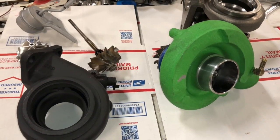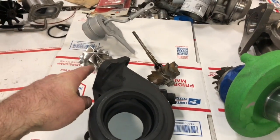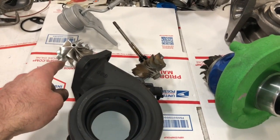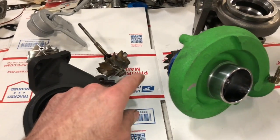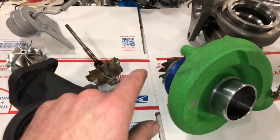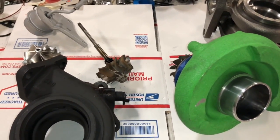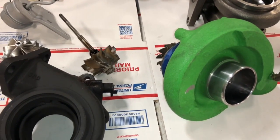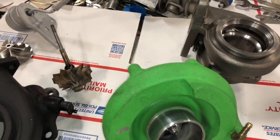If you do want to rebuild this turbo, the easiest way is to replace the compressor wheel with a 20g wheel with the standard shaft bore as a Mitsubishi, and to replace the turbine shaft to a TD06. But you have to machine the turbine housing to fit it, because the original turbine wheel is an odd size. I tried an SL2 turbine but it's not big enough, so you'll have to machine it to a TD06.